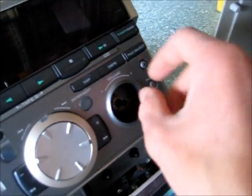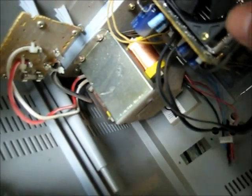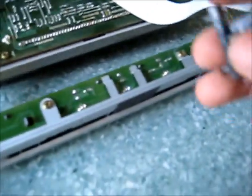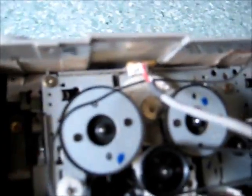First thing first — get some compressed air and clean this dust out before I put the rest back together. Another tip: when you're putting these little knobs on, get yourself the right size socket, preferably one of those long types. Pull it around it and carefully try and get it to the start, then use that socket to tighten it — much easier, does less damage than pliers, and you get more control over it. I'm going to give these a good blow over and then we can put it back together.